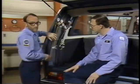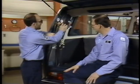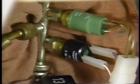Now before you hook up your gauges to the high and low pressure service ports, make sure both gauge valves are closed. Now on a camper, we'll need to remove this panel here inside the cabinet to gain access to the high pressure service port. Also, we'll want to put a rag over the service port whenever we're connecting or disconnecting the gauges to make sure that we don't spill any AC oil or Freon on the interior.